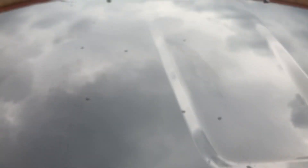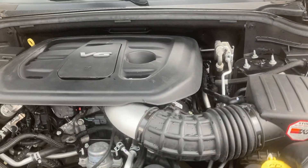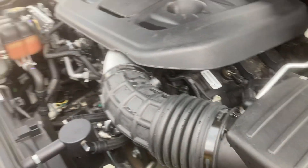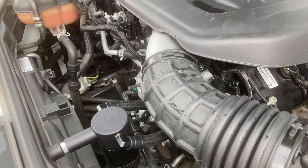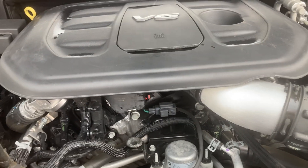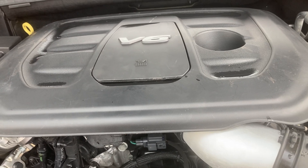If you look under the hood, I did a custom air intake — I wouldn't call it a cold air intake, but I added a K&N filter plus an SRT elbow from a 6.4 liter 2018 SRT Grand Cherokee. The only thing I had to do to this is plug it — I used an M8 bolt to do that. I also added an aluminum pipe, and underneath there's a 90 degree elbow from the throttle body to a 3 inch diameter elbow — I think that's a 15 degree elbow.